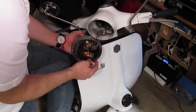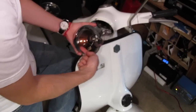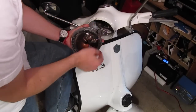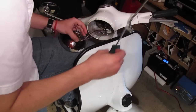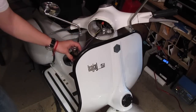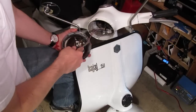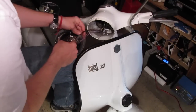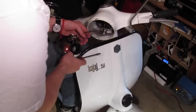At least it was ground. Okay. There's a chance that that's electrically connected through chrome or something to this outer rim. So I'm going to switch those two wires there. Actually make it chassis ground. If that's ground and that's hot, or you know, negative and positive, you'd hate for the positive line to feed back into that system.